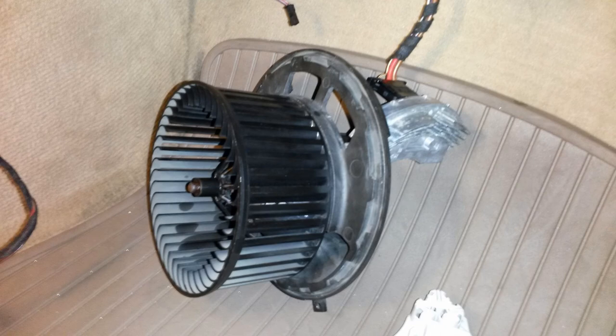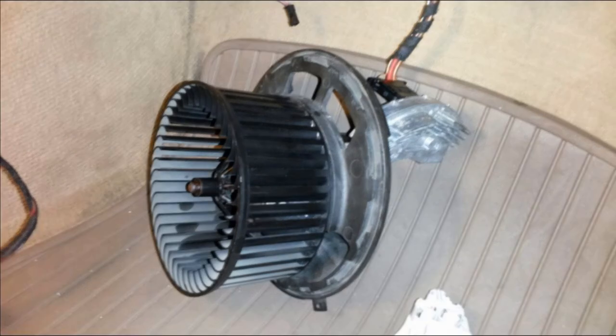After cleaning the area of contact of the rotor with the brushes, I reconnected the final stage resistor with the blower left on the floor of the passenger seat, activated the blower via the dashboard, and it started working. The problem was bad contact between the brushes and the rotor on the blower. As soon as I fixed that, the job was done.